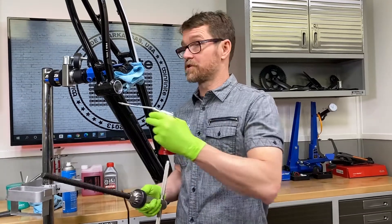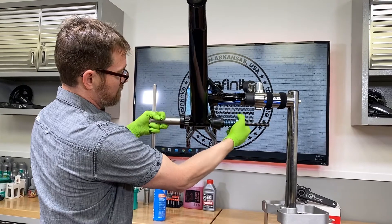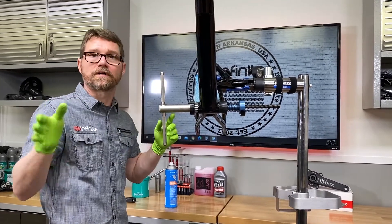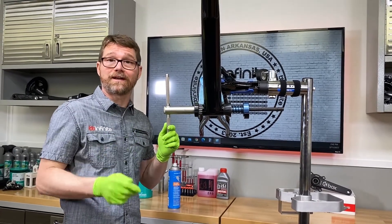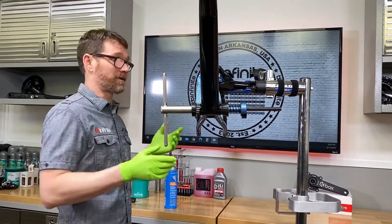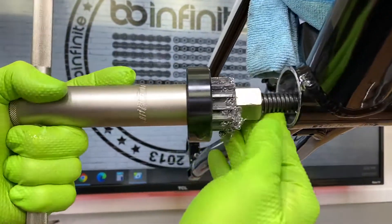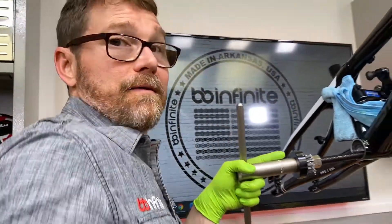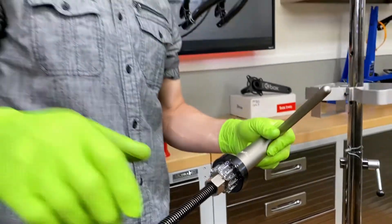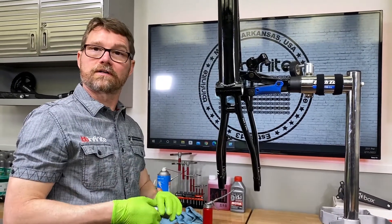I'll put a link below to the long version explaining how this reaming process works start to finish. I'm only going to ream the side that was giving us trouble - the undersized side. The other side I'll run the reamer through just slightly to catch any high spots, which will make everything 40.98mm - if it's slightly smaller it will cut, if it's the same size it leaves it alone. Pulling this out now, you can see we had some material removal - it was too small so we needed to make it bigger. That's a pretty good explanation for why the bearing wasn't rolling well - it was getting over-compressed by quite a bit.